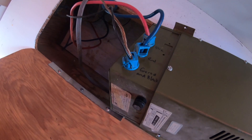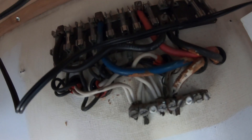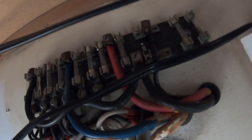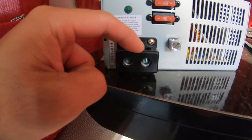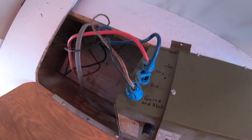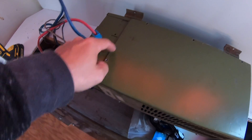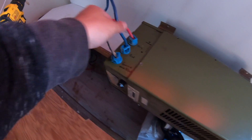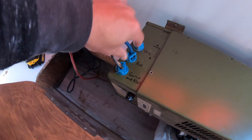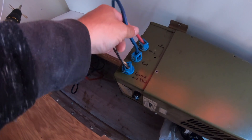Realistically, one of these is probably delivering power out to the power jack and the other to the 12-volt fuse panel. The red and the blue are both connected up here to the old fuse panel, and neither is at the ground bus bar, so those are probably both hot. The problem is, if I've got two hot wires, am I going to have to squeeze both of them into the positive terminal? I'll pull this top side panel off and see what's inside.